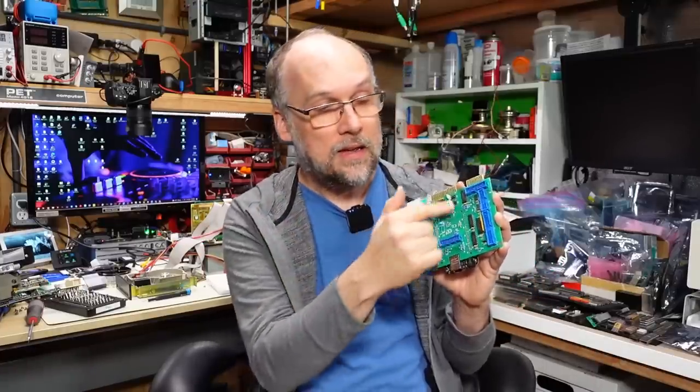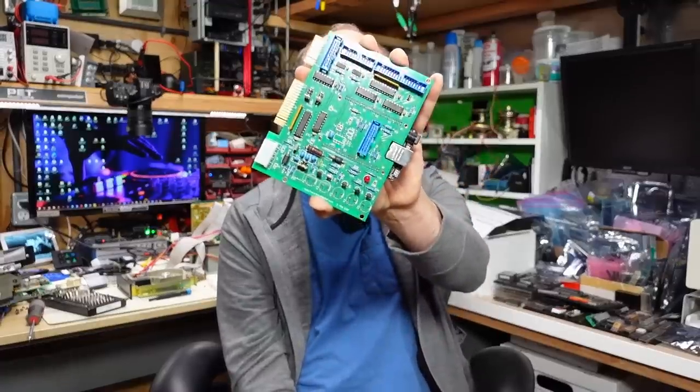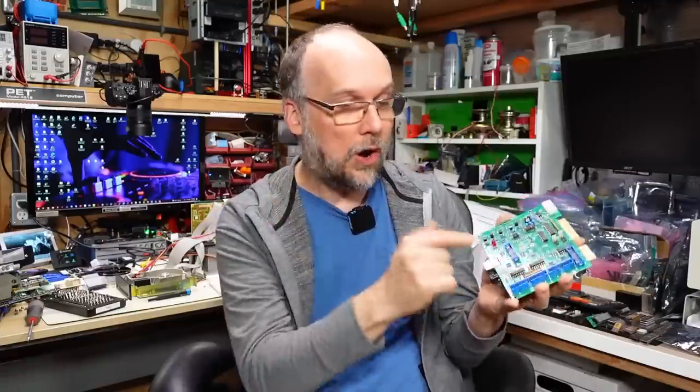But this thing not only can emulate one of these hard drives for your old systems, but you can also take one of those drives that's working and connect it up to these connectors on this board here. And then this can actually save what's on that hard drive, make an archival image onto this system. And you can use Ethernet here to copy the image off of it. What's great about that is plenty of those hard drives used on non-PC systems are going to have formats on them that might be completely different and incompatible with whatever the controller is that's used on the original IBM 5160, which I have sitting right here. In that case, the PC is not going to be able to read whatever data is on there, but this thing should be able to. It's just going to take that raw bitstream data and save it to a file.